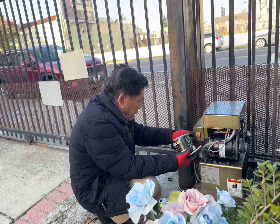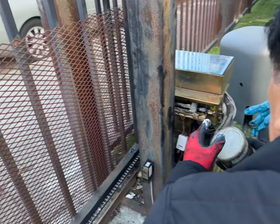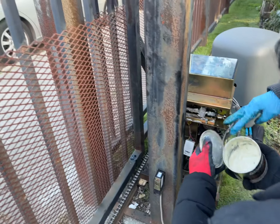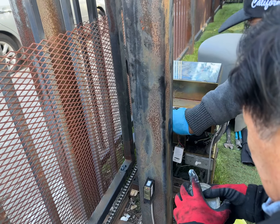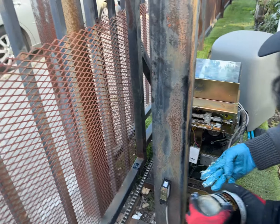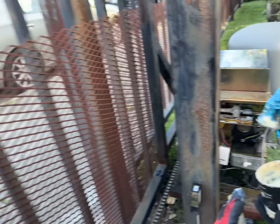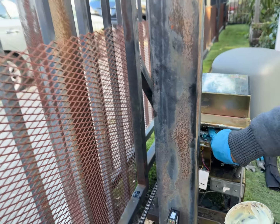Someone said the main complaint was the automatic shutoff switch right there. I wasn't here to watch this thing fail, but by the time we put it back, it's working now. I did check the capacitor — I think it was around 60µF. We did put 90 gear oil there, and I don't know if somebody messed with this micro switch to be on and off. But everything works good, and we lubricated everything.